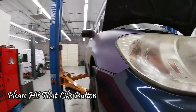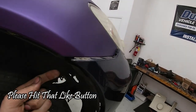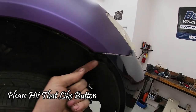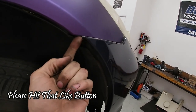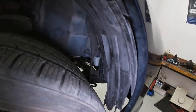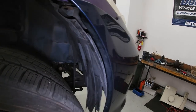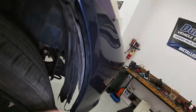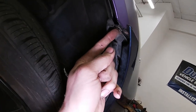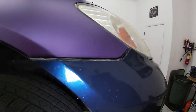Over on the sides we'll have to undo it from the fender. This side I already have popped out — there's one on each side: an 8 millimeter screw that goes up through there. Traditionally if your car has proper fender liners and they're not all eaten up, you'll have more to undo. There's one 8 millimeter screw and then it has snaps that actually pop into there.